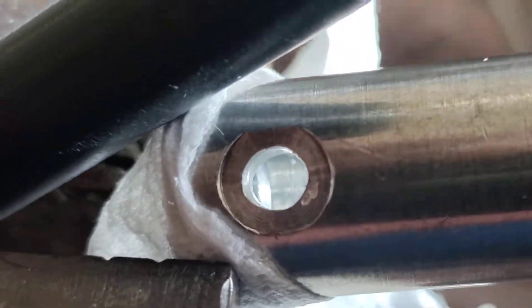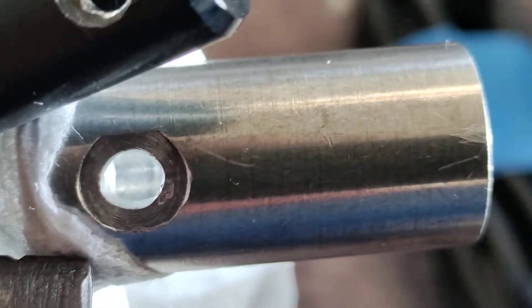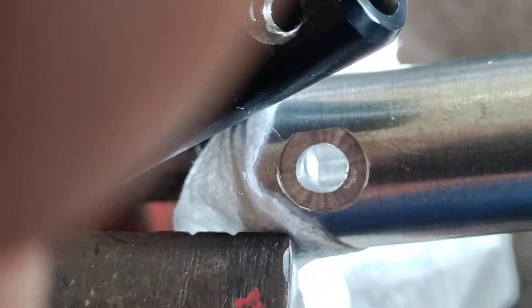So inside here is our valve. Normally these just go straight in and out. I've got this zoomed in so I can really show you the radiusing. Right in here — you can just see everything has been radiused and polished evenly. It's basically looking like an intake runner on a race cylinder head. You can see the short turn like a valve going in.